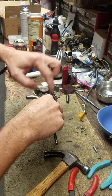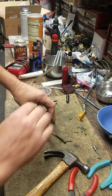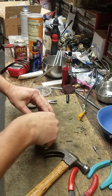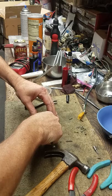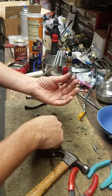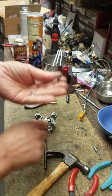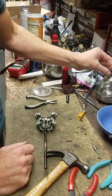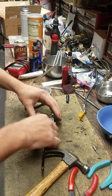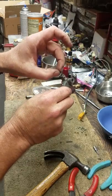Gently put your fingers here because there's two ball bearings in there — they're going to shoot out if you're not holding on to them. Just kind of work it up, get your finger in there, nice and easy. There's your ball bearings — they're greasy, they're goopy. Part of the problem this thing was having such a time to turn. Drop them in the bucket. Pull that out, take the spring, pull it out.